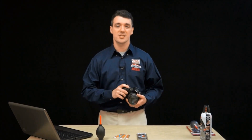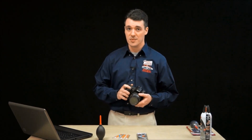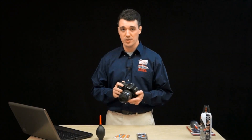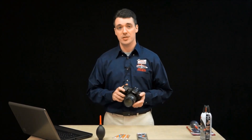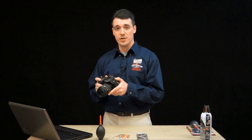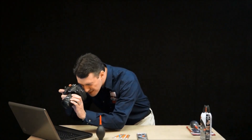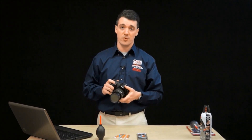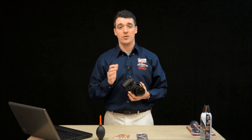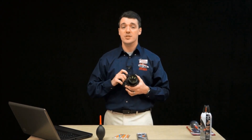First, you'll want to take a test image to see exactly how dirty your camera's sensor is. Start by setting your camera to aperture priority mode, and set the aperture to the smallest available setting — F22, for example. Then use a blank white sheet of paper, or a blank white document on your computer screen, and take a picture. Move the camera around during the exposure to make sure it's a little bit blurry. Fill the entire viewfinder and take your shot. Then transfer this photo to your computer and use Photoshop or another image editing program to look at it. You should be able to see dark gray blobs wherever the dust is on your image sensor. If you're using Photoshop, you can use auto levels to see it much more clearly. As you can see here, our D300 is filthy.